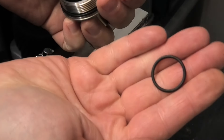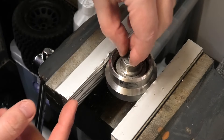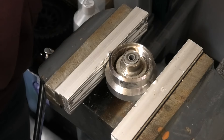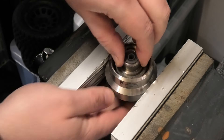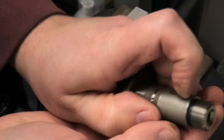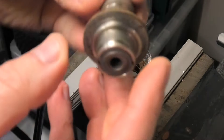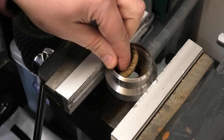Underneath there is another o-ring that seals the top of the spinning shaft on the inside. I'll go through the sizes later in the video. This is the main spin shaft from the internal side. There's a seat in the top — that will come out but can be a little bit fiddly. You're better off just leaving it in there unless you want to change the o-ring on the inside. From inside, that just pops straight out, and that is your main shaft. On the bottom you've got a very small o-ring — about 1mm — that seals the bottom of the arm, and on there is the bottom part of the actual thrust bearing, which as you can see has seen better days — very rusty.